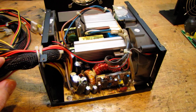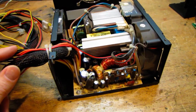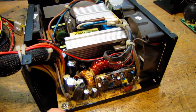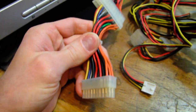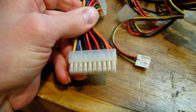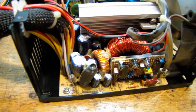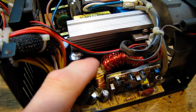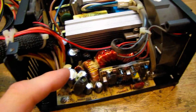The reason the plus 5 is so big is that back then motherboards didn't use the 12 volts to power the CPU voltage regulator, and most video cards didn't require a separate power connector either. So most of the power was available on the 5 volt circuit, which is why this filter choke is so big — 52 amps. The wires are heavier gauge than most later power supplies. This was one of the very first power supplies to use a 24-pin motherboard connector, so they included an adapter to connect to the more common 20-pin connector. It had some of the cheapest capacitors available, but they still lasted because of how well the power is filtered before it gets to the capacitors — with a choke like that, and the size of these heat sinks and output transistors, the power is very smooth before it even gets to the capacitor.